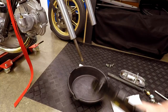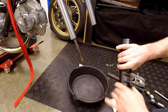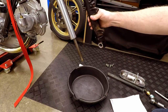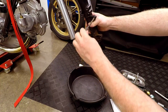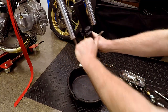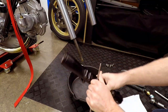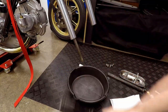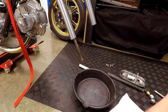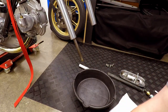Because you can't get a good grip on this thing necessarily, you might need a stronger grip than you realize. What I did was I took this drift, put it through the brake bracket hole and just held onto that — plenty of force in that. In the end it just popped off straight away, but that gives you a good hold. Put a tray underneath of course. You could drain the fork oil first — doesn't really matter, it's not that much that comes out, a couple hundred mil.